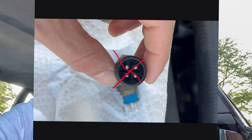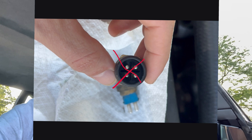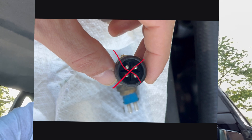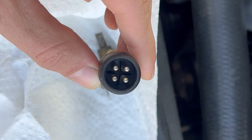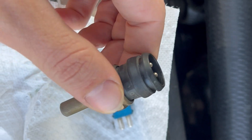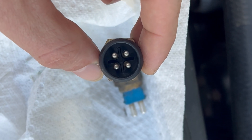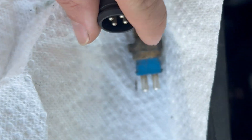You can test the four-pin sensor by taking resistance diagonally — there are two pins diagonal of each other and you're going to take resistance of both and compare them. If your coolant temperature should be really cool and you haven't started the car, you shouldn't be getting resistance that would lead the computer to believe it's 150–160 degrees, i.e., operating temp. This is a four-pin with no hot and ground — it's taking two signals and calculating a temperature at the time you go to start.